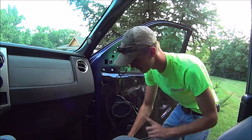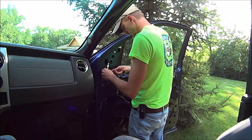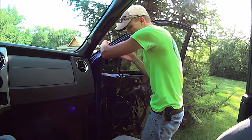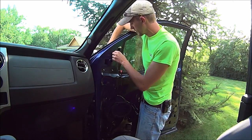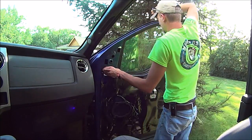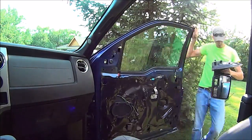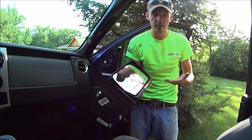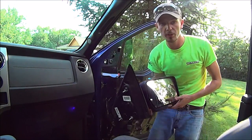Let's take off the old one and put on the new one. There was a horsefly in my truck — I did not want it there, it had to go. Now make sure to hold the mirror from the other side as you're taking off the last bolt. I took off the bottom two and just loosened the top one — it looks like it'll hold. Alright, the old mirror is off — this little dinky one that I think is pointless for any big truck is gone. Let's go put on the new one and see how it looks.